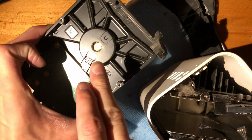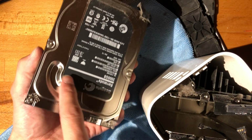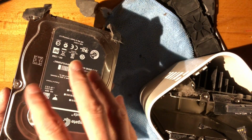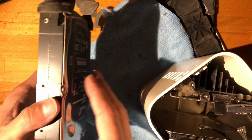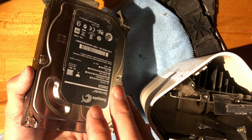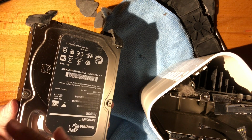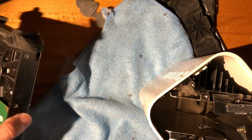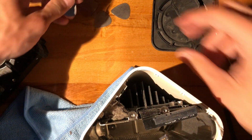What I will actually do is connect this up with a SATA adapter and run a long SMART test, and that'll reread all the sectors and heal the data if there are any bad sectors, like force a detection of all sectors. It's good to do that from time to time, so I will do this on this drive. Doesn't matter what format it's in, the SMART tests, the long and the short one, are agnostic to that. They're completely transparent. They will let you use the drive while they run. So yeah, I'll be doing that. But until then, let's unscrew this.